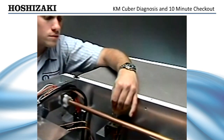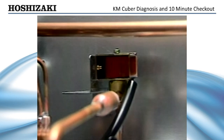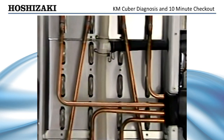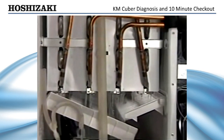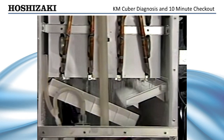To do this, lay a metal paper clip on the coil. If you can feel a magnetic pull, the coil is energized. If the coil is in fact energized, it is possible that the hot gas valve is stuck. A stuck valve should be replaced using proper refrigeration practices. With normal operation of the hot gas valve, the evaporator will warm. At 48 degrees, the thermistor will start the defrost completion timer. The average harvest cycle in average ambient temperatures will range from 2 to 4 minutes. Longer harvest will occur with colder supply water or if the defrost completion timer is adjusted longer.